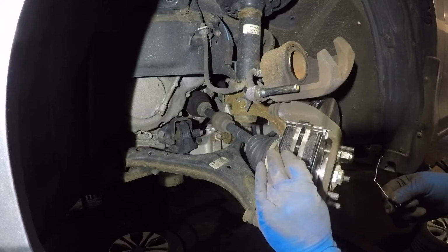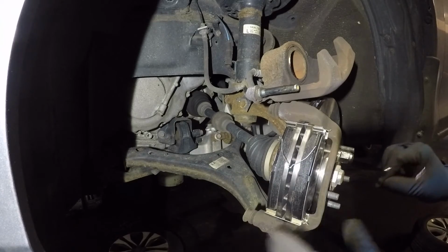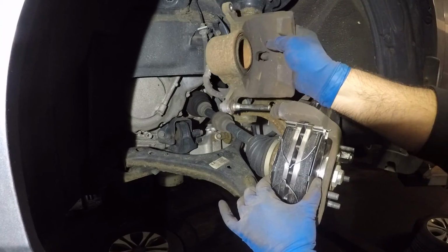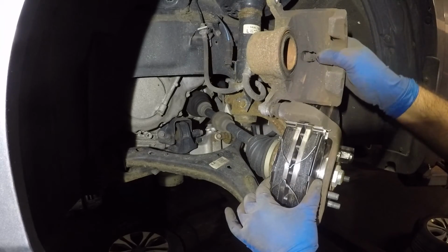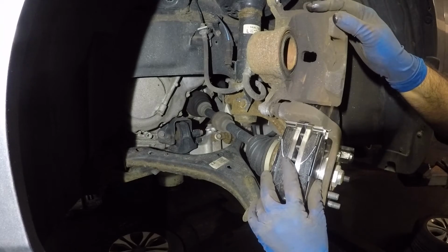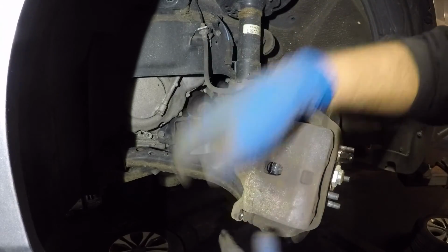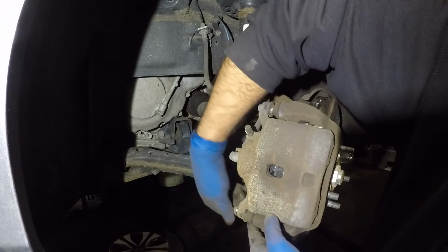It's gonna come with the new clips, new of these spring-loaded retainers. Take these. You do need to hold it because right now, you see, I got lucky there. Usually, it will throw the brake pads off, especially once you do the bottom one because there's a lot of force there. So hold it with the one hand, guys, and you're gonna take this little guy, and you're gonna stick this on, all right? Sometimes when you take it for a test drive, this thing will go touch the rotor, right? So if you're hearing a squealing noise, look into it, right? Sometimes you have to bend it a little bit more, or it's not in perfectly where it's supposed to be at. And there I have it, guys. Take your number 12, put the number 12 on, and that's it, guys.